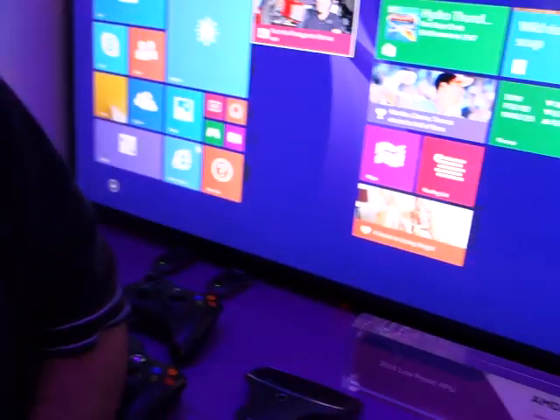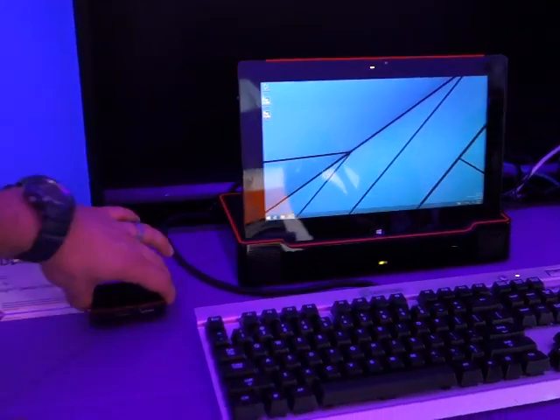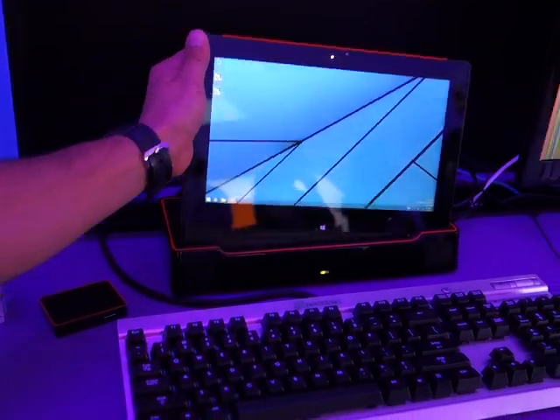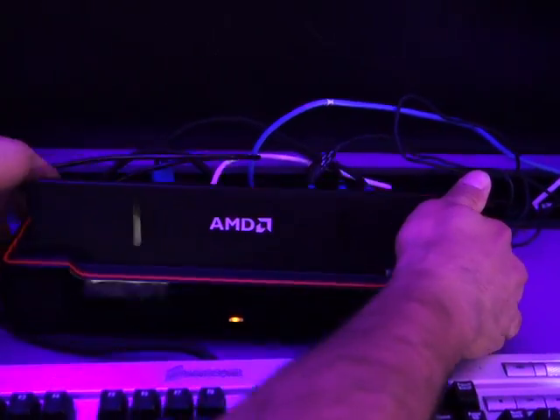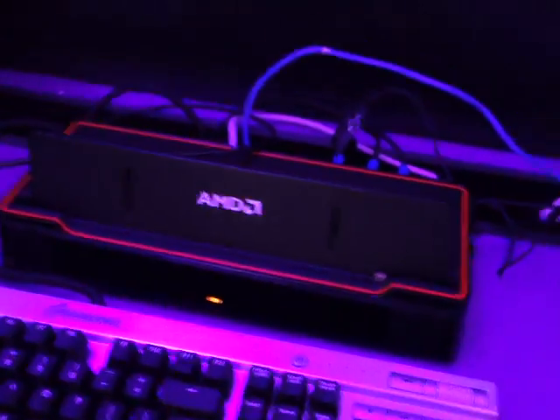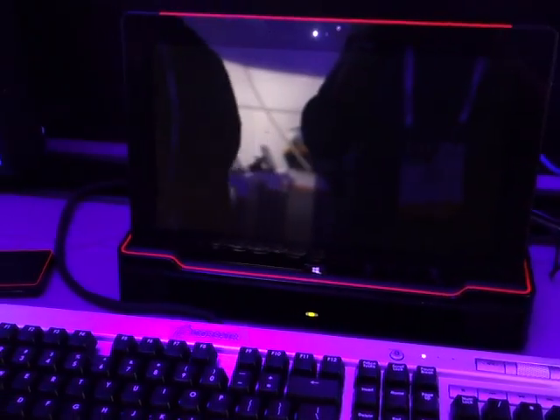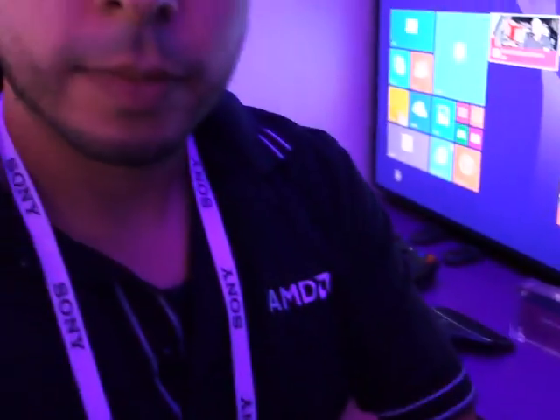And I think we have a slightly bigger version with more USB ports over here. This is the large version of the Nano PC dock. Here we're doing charging over dockport. We've got the same dockport connector, and on the dock — let me lift it up so you can see the back — we've got a mini DisplayPort out, a few USB ports, a NIC, and audio. The display interface can be whatever you want. We use mini DisplayPort because it's simple. So this, in addition to allowing more USB ports, acts as a device that allows you to use your tablet as a desktop.